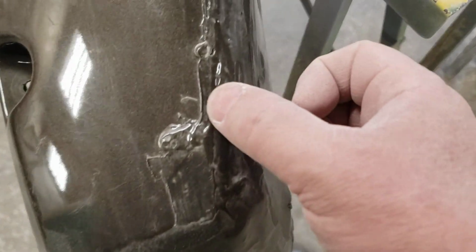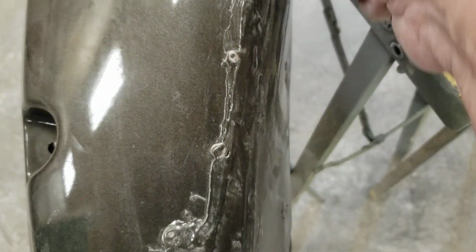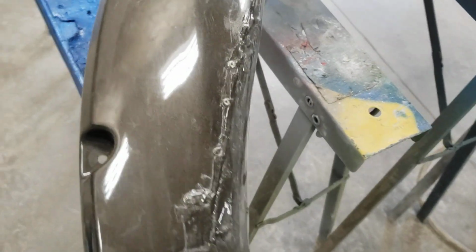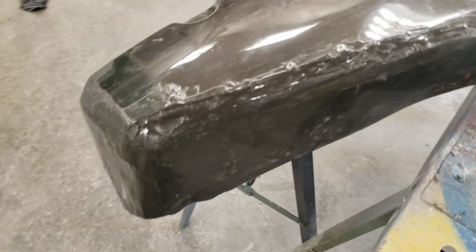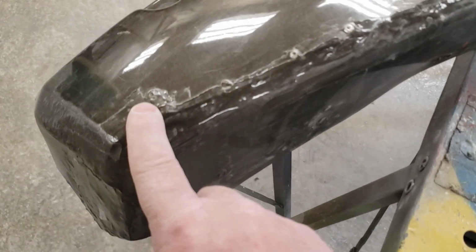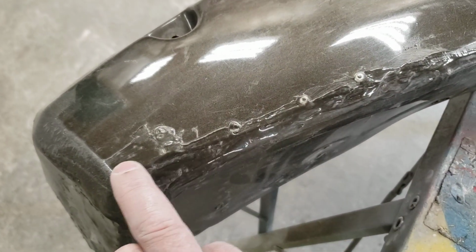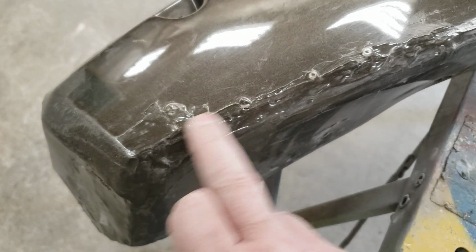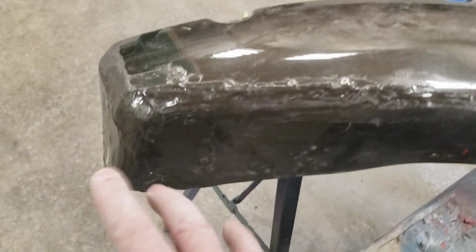So what I'm going to do now, like here, obviously, because I pulled the plastic under, it left a big lip the thickness of the plastic. So I filled all this with the filler. Now you can bodywork and paint right over this glue stuff, as far as I know. At least I hope so, because that's what we're doing. What I'm going to do now is sand this off with 80. I might lose some of the rivet heads. Some of them are sunk a little bit, but it's so glued that shouldn't affect anything. Most of them will still be there.